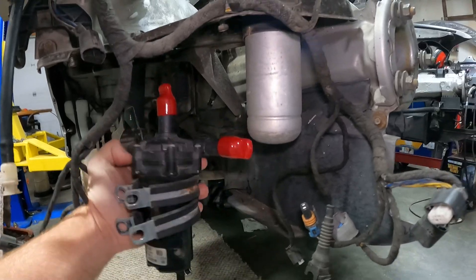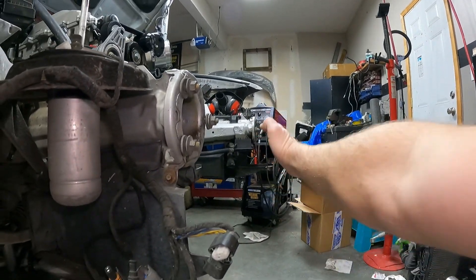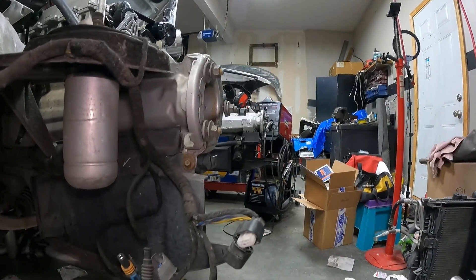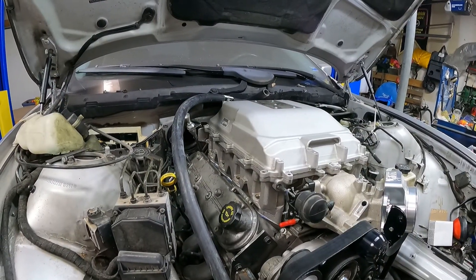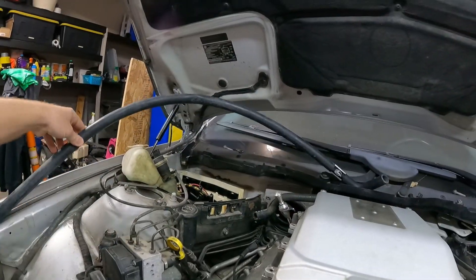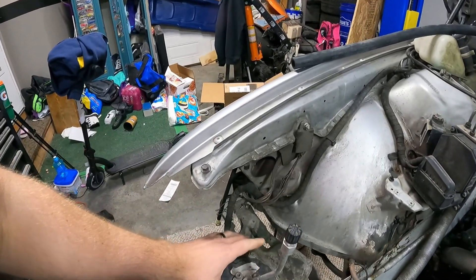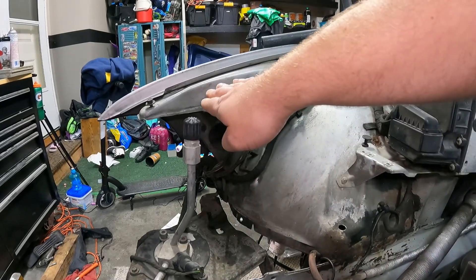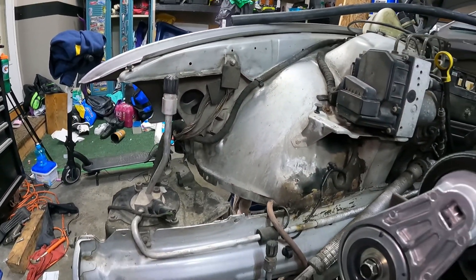The outlet can come out the front here, then I'm going to put a heat exchanger right here in the front. It'll go out through that heat exchanger — I haven't got that far yet, I need to get the radiator on first — and then it comes back into the intercooler brick on the inside of this lid. I have to make sure I don't get in the way of the AC lines, so it's only going to come to about right here, and I want to keep it below the hood line. It'll hold maybe a gallon or two, which is still better than what a factory CTSV does.